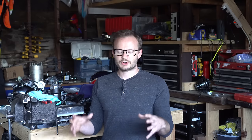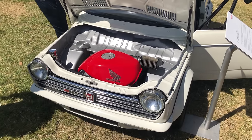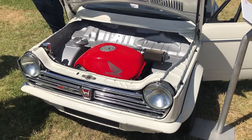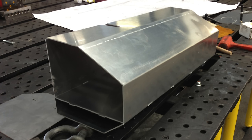The easiest thing to do for the fuel system is to just take the whole fuel tank off of the motorcycle and bolt it into the car. I've seen this done on a few motorcycle swaps and it seems to work out pretty well if you've got the space. You might have some problems with fuel slosh at low fuel levels because motorcycles lean and don't actually see lateral acceleration. Another solution is to just get an aftermarket pump, filter, and fuel line and run it from your existing fuel tank to the engine.